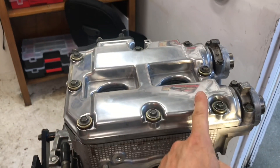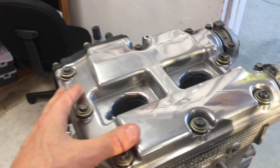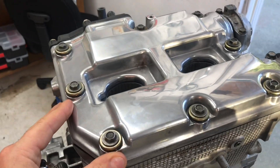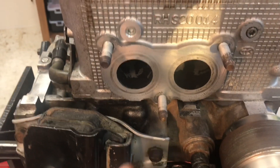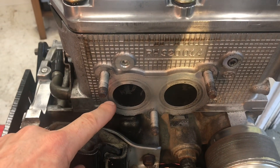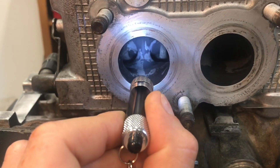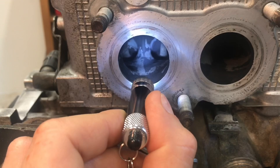In this right head, this is actually cylinder number one and number three. A lot of times there's actually a turbocharger sitting right there, so there's tons of heat building, and yet cylinder number three doesn't seem to have the problems that cylinder number four has. I think a big part of that is the coolant flow through the heads, but it's also the exhaust port configuration. With the engine rotated like this, we can take a closer look. What you're looking at is the exhaust ports for both sides of the right-hand cylinder head — cylinders number one and number three — with two exhaust valves inside each port. Both exhaust valves for the number three exhaust port actually have a straight-through shot right out of the exhaust port, into the header, and down through the exhaust system.